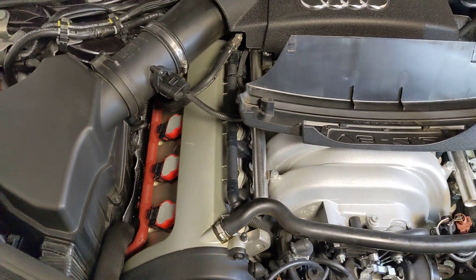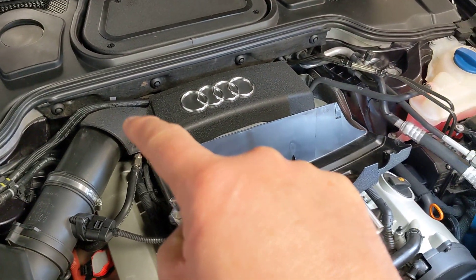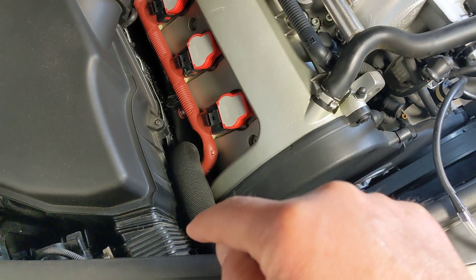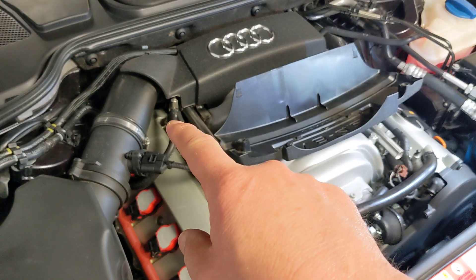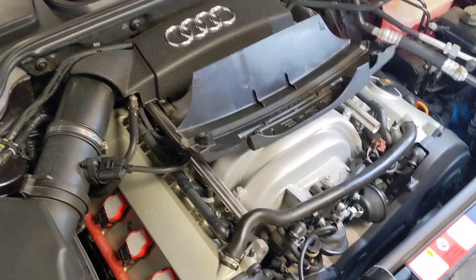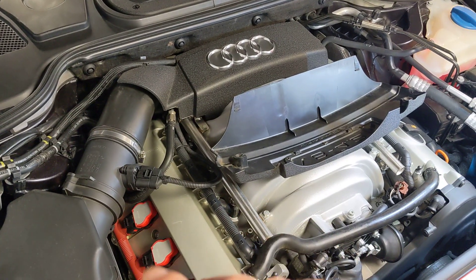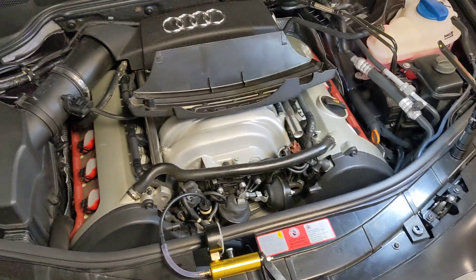What I also did was follow the service manual and did a test of the combi valves on the back of the engine. I applied a vacuum to them independently, and then — as the manual says — you blow into the line that comes from the pump down there. I disconnected the hose that leads up to the combi valves and blew into it — there was full resistance, couldn't blow into it. Then with the vacuum gauge, I opened each valve independently, and when I opened the valve with vacuum, I was able to blow air through the system quite easily. Each side appears to be clear. So I'm stumped and looking for some help — thanks in advance.